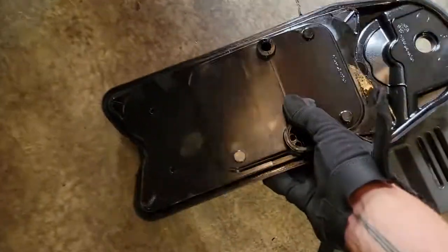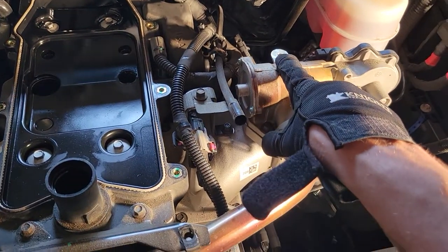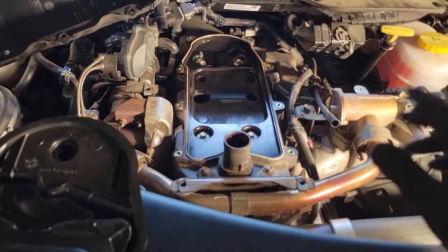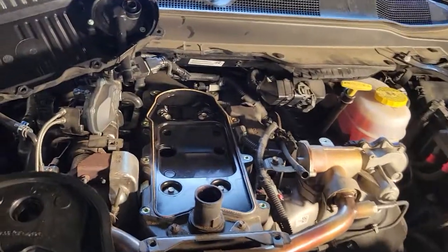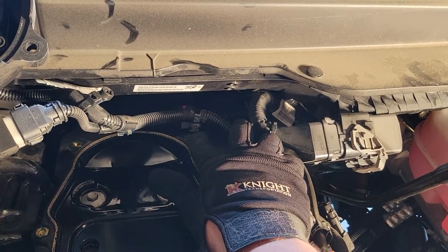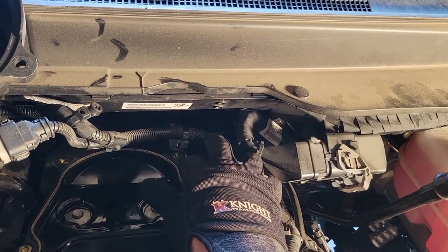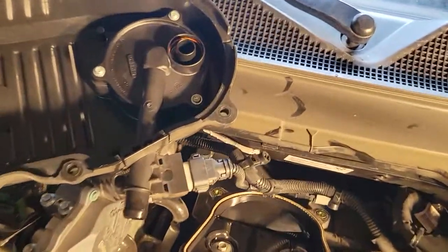Getting this off is actually very simple. You're gonna remove this cover, which is just four bolts located right here at the front — one right next to your oil pickup tube, a second one here, same on the other side for the third, and same over here for the fourth. Use an eight millimeter wrench; I loosened them with a ratchet and finished them off with my electric ratchet. A couple of them are gonna be longer bolts — that's for holding these wires in place. You'll see little connectors that snap on top of the bolts. For the longer ones in the back near the firewall, use a swivel and a deep socket, about a quarter inch, and you'll be okay.